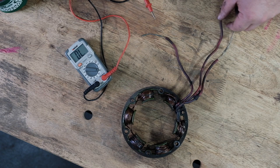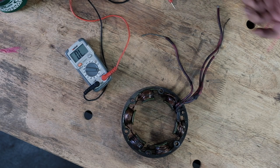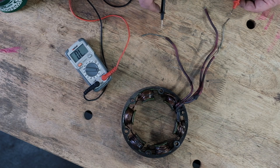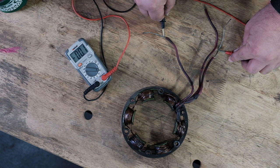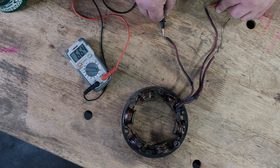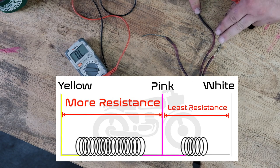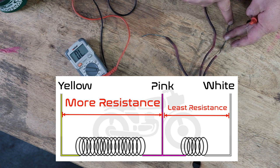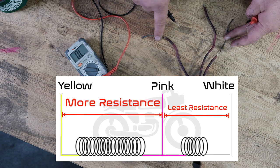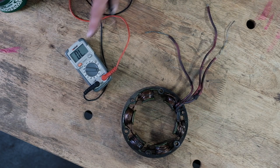Now you might ask which one is the white and which is the yellow. It doesn't really matter, but we can actually figure it out — these should be combined. You can reference our white-yellow wire mod video for that. The one with the higher resistance of the two combos: we know this is our pink. This one was 0.5 ohms, and this one was again 1.1 ohms. So this is going to be the yellow — the primary charging wire. And this one is going to be the white secondary charging wire because it has more resistance. This combo has the least resistance in reference to the pink, which is our common. So: pink, yellow, white — all based on resistance readings. And we got readings through the whole coil, so it has full continuity. It should be good to go.